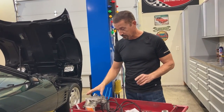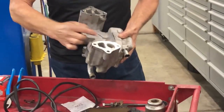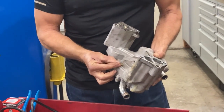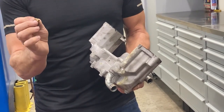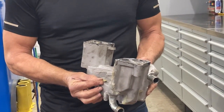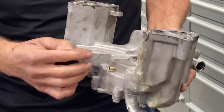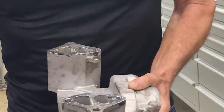There's one more modification to do before you put it all back together — on the water pump. This is what drives the water pump right here, and this is the weep hole. That little connector that you bought fits right in there. Put some JB Weld on that — but rough these up first with sandpaper so the JB Weld has something to bite onto — and just glue it on just barely in there. Let that dry. Then hook a hose to that and run it down the side so that if the water pump ever does leak, it's not going to leak all over your OptiSpark — it's going to leak down on the ground. You'll still have a problem with your water pump, but at least you didn't kill your OptiSpark.